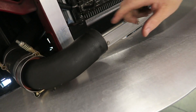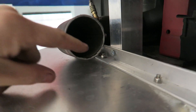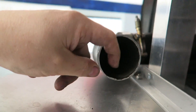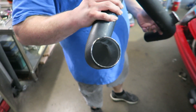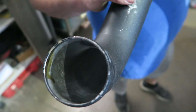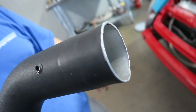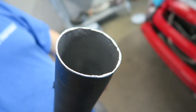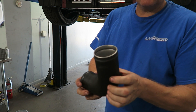Also notice here, these charge tubes — they're not bead rolled, which means they will blow off under boost. They also have a raggedy edge which loses material and is not good. Another charge pipe came off the car — it's got a bead on this side, but on this side it's not beaded. It's a terrible cut with a lot of raggedy material that could end up going inside the engine.